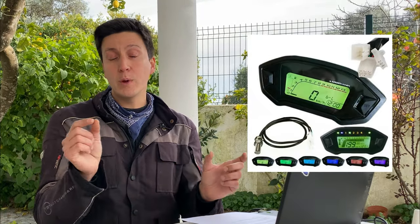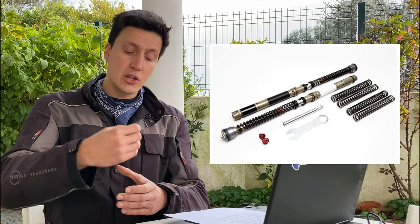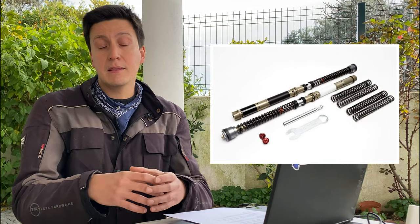A possible solution for this is to buy a digital speedometer with a digital pickup. Six: if all of this is just too deep for you, remember that you can simply upgrade your original fork. Some aftermarket brands sell cartridges that go inside the original forks — not only do they update them, but they also make them adjustable. That's probably the easiest way to improve your suspension.